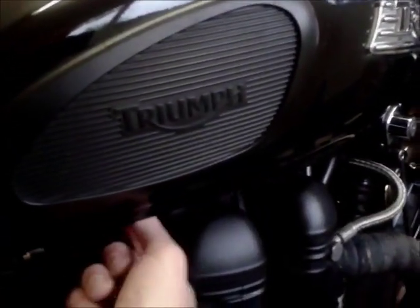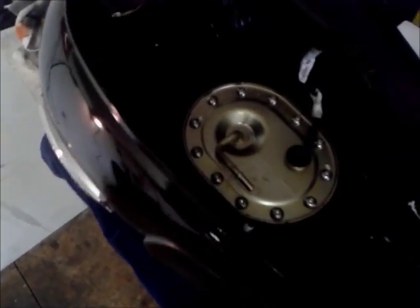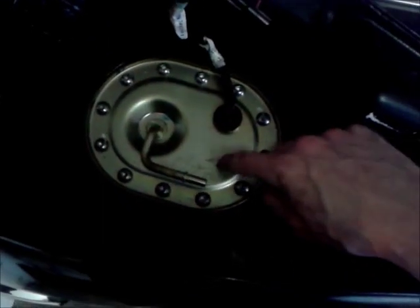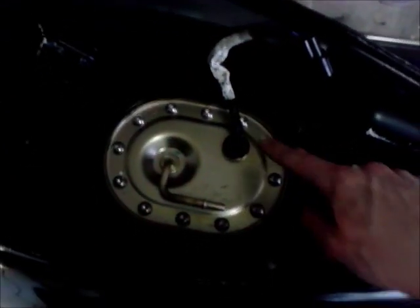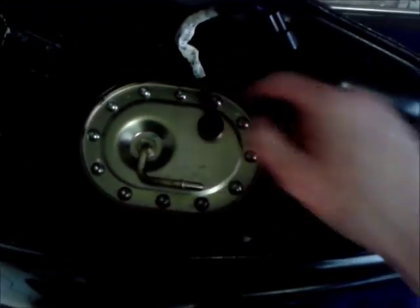And then I'll have to just lift the tank up, and then you will have seen on one of Del's other videos a little clip. But I'm going to need two hands for that. Okie dokie, so turned it over now, hardly any fuel left in it. So this plate underneath here, and this is obviously an EFI model, fuel injected. You've got everything basically on this base plate underneath here. So I've just got to undo all these Allen bolts around here.